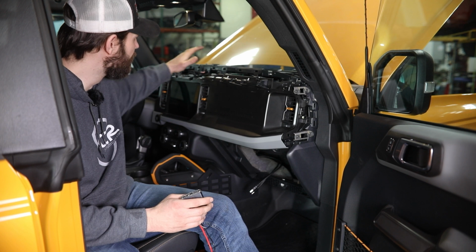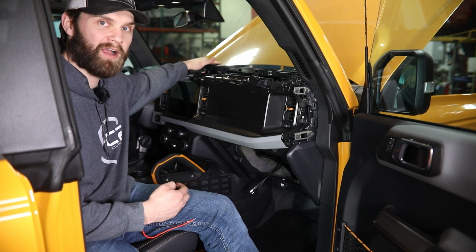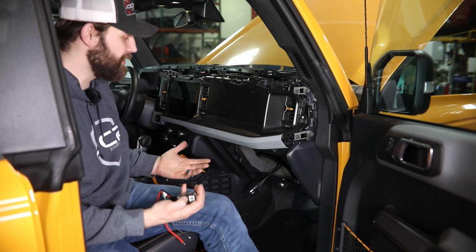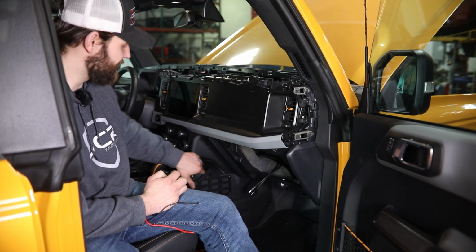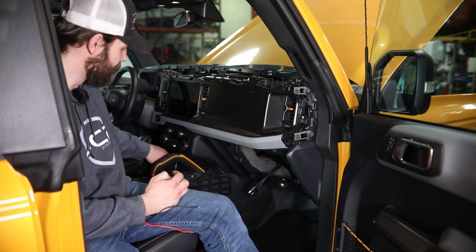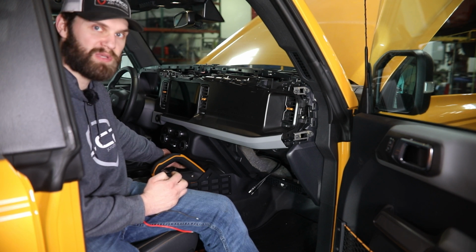on how you want to power these outlets up here. So if you want to be able to plug things in up here on your mount and have them be directly linked to the vehicle for things such as Apple CarPlay or something similar, you're going to want to route these over under the center stack of the dash, likely through this lower bottom panel that's easily accessed and easily removed, and be able to plug them in here to your center factory USB location.